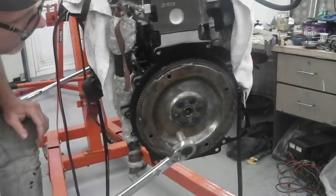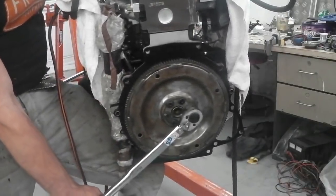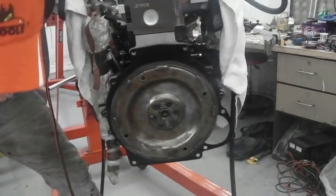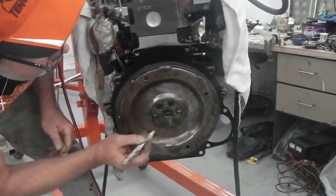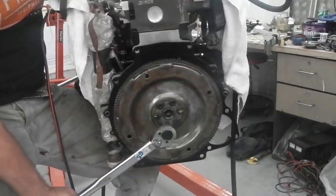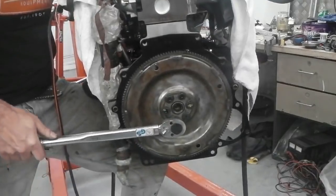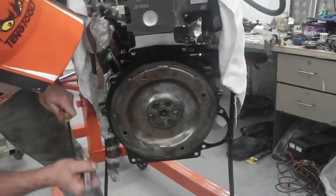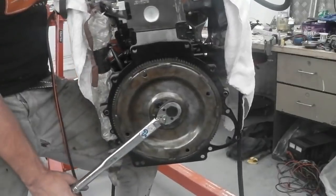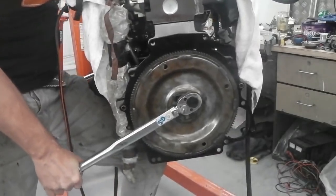Now opposite. We're going crisscross. I'm trying to stabilise. It's a little bit tricky, but it'll go. Up we go. Oof. That's that one. Hope you can still see there. Right. Opposites. Next one. Holding the crank with a 19. Knee just under the sump a little bit. Boom! It's that one. Opposite that one now. Up we go. Here we go. Locking that. Come on. Boom!